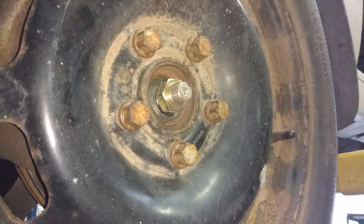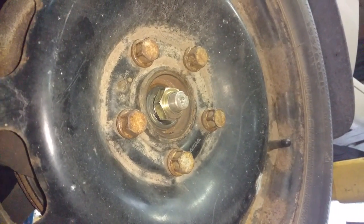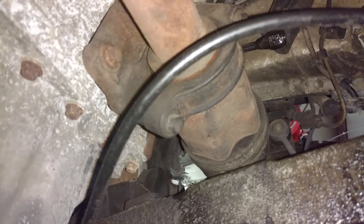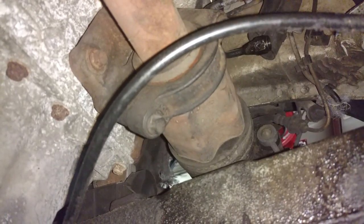36s or 30s or 32s. After that, you gotta take the tires off, 19mm, or with the tire breaker bar. On the passenger side, you gotta get those carrier bolts loose. They're 12mm. Take both of them out. At this point, I'm ready to lower the subframe down so that I can pull the last couple of bolts out of the transmission and unplug the transmission from the engine.